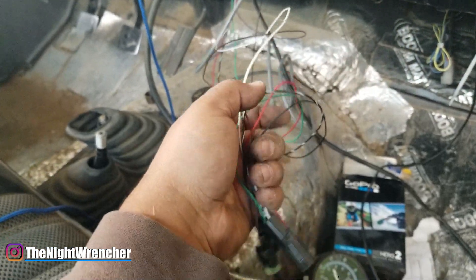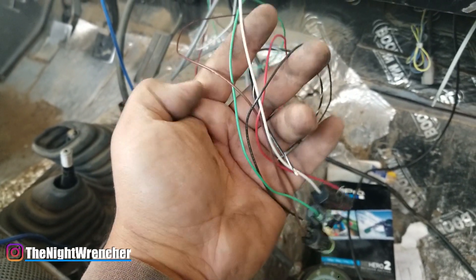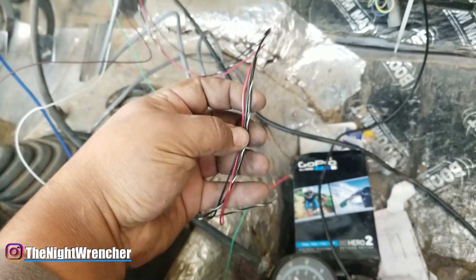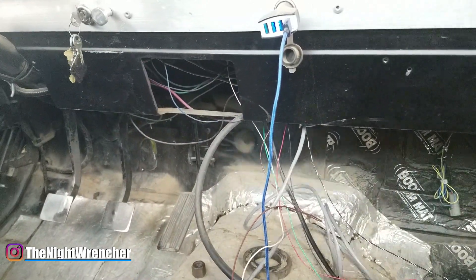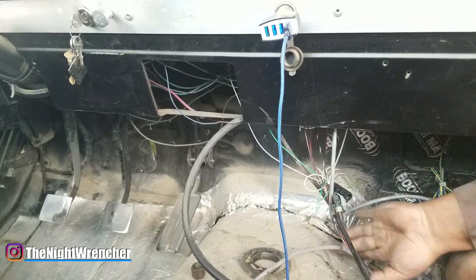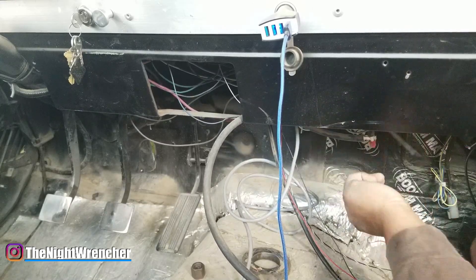I've got the six wires that come off the gauge itself. From these six wires I'm actually going to be wiring up only three. The green, white, and brown ones belong to data logging so we're going to ignore those. The ones we're actually going to be wiring up are the two black ones which go to ground, and then the red one which goes to switch power. I'm going to daisy chain all of my gauges into one so they're all going to come off the same relay, and I already have a dedicated ground for all of these, so I'm going to tie up the other three I don't need and wire up these three.